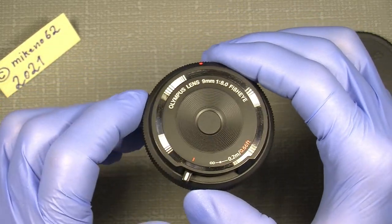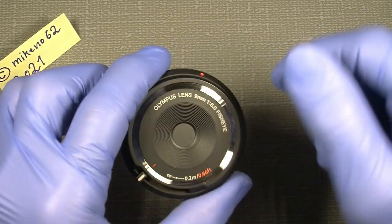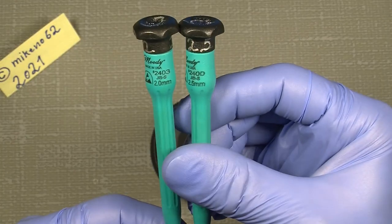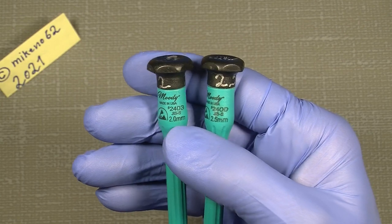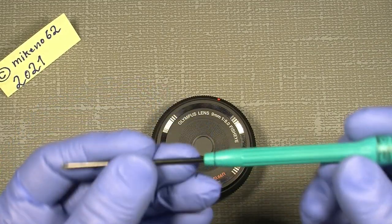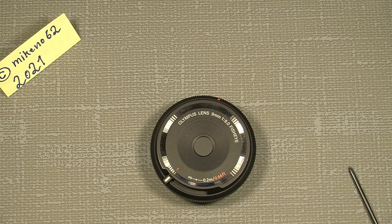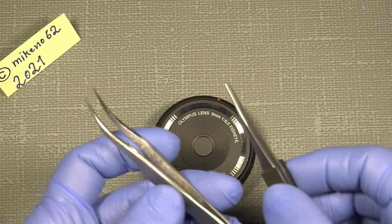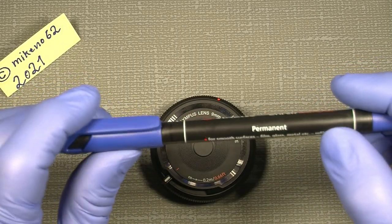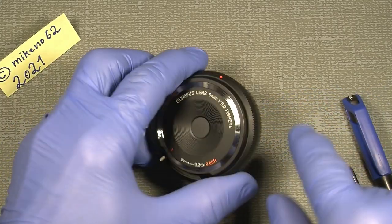And it's not so expensive. Let's see what we can do about the cleaning and what's inside. We need some tools: one or two JIS screwdrivers, a 2mm and a 2.5mm — you could maybe only need the 2.5mm. Some tweezers are always very handy, either curved or straight. A permanent marker with a fine tip is also really good, just to set small marks inside when we disassemble it.